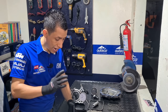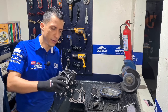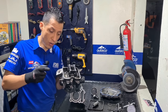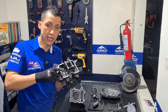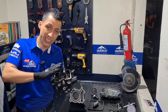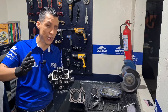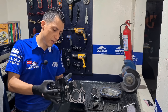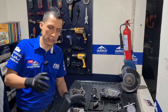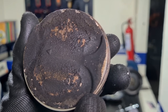We've completed the diagnosis of our valve guides. The definitive solution is to replace the cylinder head. There is a partial local solution of replacing just the valve guides, but it is not a definitive fix — it doesn't work well enough, especially since this motorcycle has a high RPM range with high user demands. Typically they fail again at 1,000 to 2,000 km — it's rare that the repair holds up well.